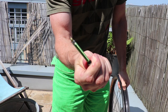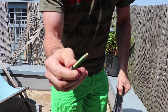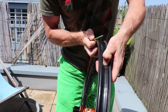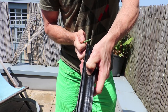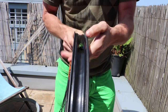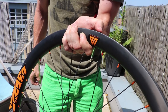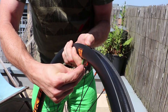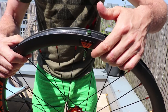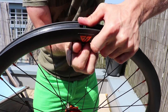Now the Cushcore system comes with its own special valve — this one is extra long because I've got a pretty deep rim, just to make sure. A lot of people will cut a hole in the rim where the valve is, but I prefer just to make an indentation with my thumb so I know where the valve is, and then literally just push the valve through. Doing it that way the hole is exactly the right size for the valve and it just helps it seal a little bit more. Once the valve is in place, get your supplied o-ring and lock nut and just thread those on by hand. While you're threading on, give it a good push with your thumb on the top just so it presses in more and you can get a few more turns on the threads.